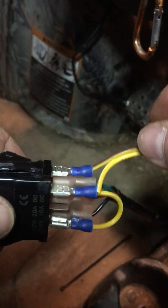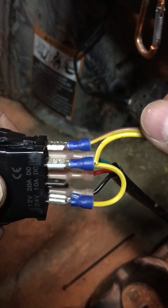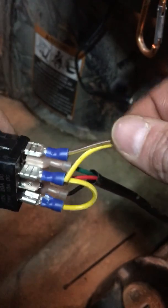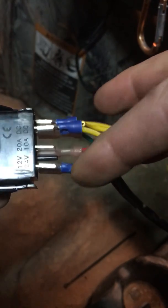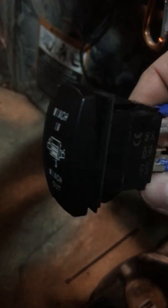I took out of my panel the wiring harness in my Gator 825i. I used an old piece of trailer wire — the brown is ground, the yellow is the ignition hot. I run it to the top pin, skip the center pin, and made a little jumper out of it to the bottom pin. The switch stays lit no matter what.